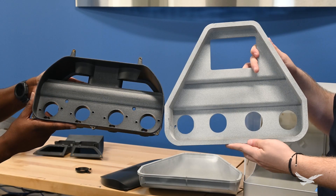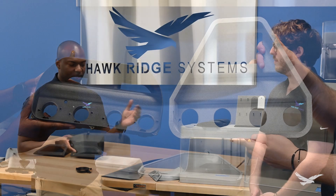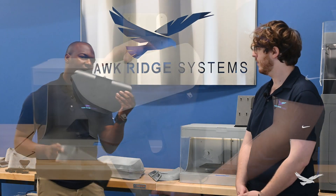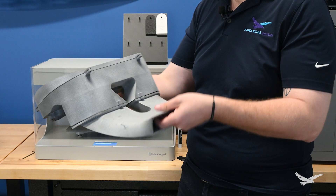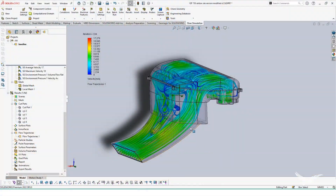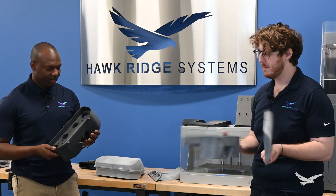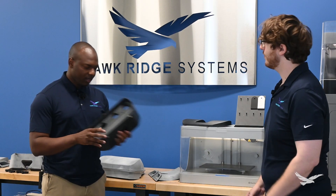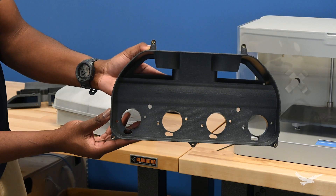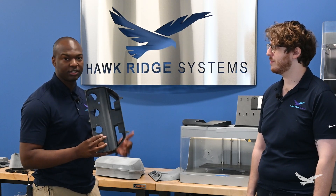With the reference bodies, I was able to map out exactly how to route the RAM air. After the initial design, we ran a flow simulation and saw some turbulence toward the front portion of the airbox. We started with a basic frame of the box, a basic lid, and basic interior features to run the flow sim. Based on that data, we made changes — I wanted to do something untraditional, something you couldn't do with injection molding. So we added these little winglets inside the interior of the airbox, which would have been really difficult or impossible with injection molding. That's another thing 3D printing brings to the table.